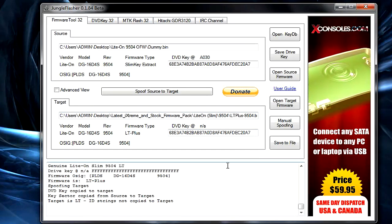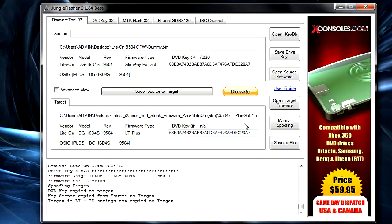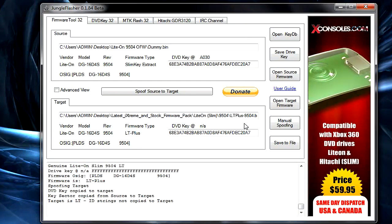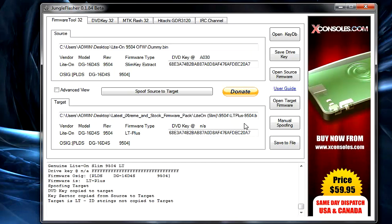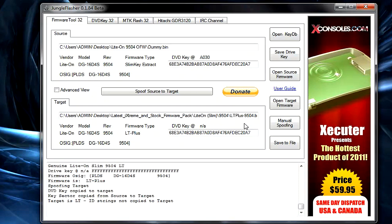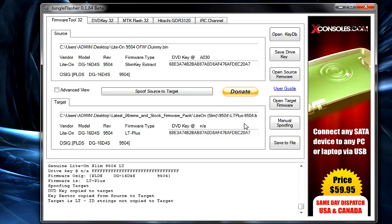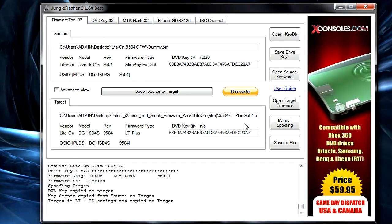The current 9504 firmware is only LiteTouch Plus 1.1, and LiteTouch firmware right now is safe to use. I've heard rumors that it's not safe, but LiteTouch Plus is essentially safe. The only reason 1.9 has come out is to support XGD3. I'm not certain if playing XGD3 will flag you, but if you don't have version 1.9 I would not recommend playing XGD3 discs — the current XGD3 discs are only later copies of Halo Reach.